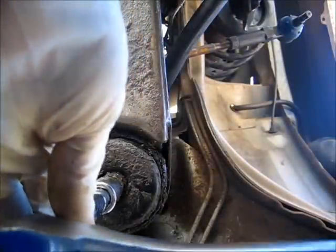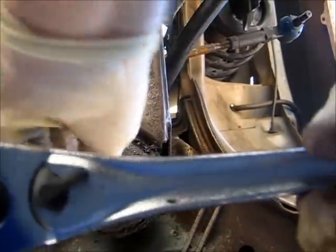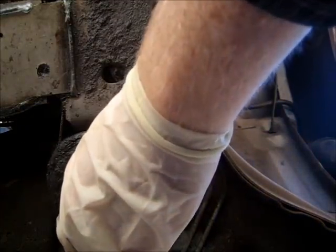I just need to clean all the dirt and crap off so we can put in the new bushing. That is one disintegrated subframe bushing. Now I just need to lower the jack and push that one out.